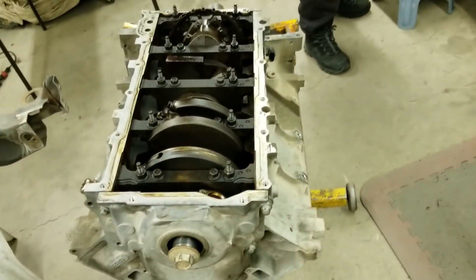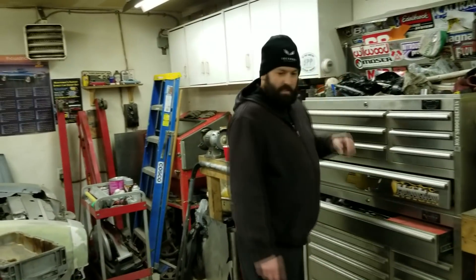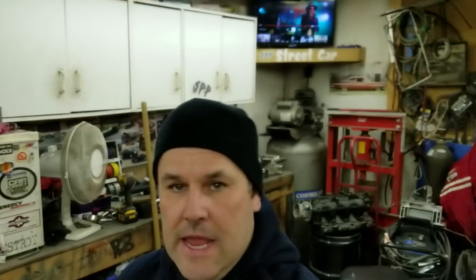So probably what I'll end up doing is put this one back together, pull another one, check it — and I probably don't even have to gap them. I guess because the engine's worn down a bit, they're already opened up. I pulled a couple more pistons out and checked the rings on those, and they're the same — 24, 26. So it's all good. I put it all back together. Short block's ready to race. Clayton is prepping the oil pan to take it to his work and cut it about a quarter inch more. I actually ended up pulling out a couple more pistons — kind of forgot that number seven is the piston I had changed before. That one had different rings on it, but I took it apart and the rings were good. So now it's all back together, it's ready for paint, it's ready for the cylinder heads, and then hopefully it goes back in the truck. So that's going to be it for this video — like, comment, subscribe, and I'll check you later. Bye.